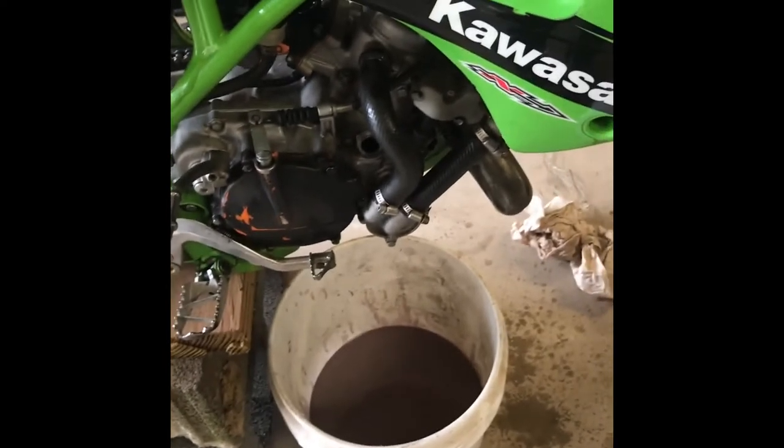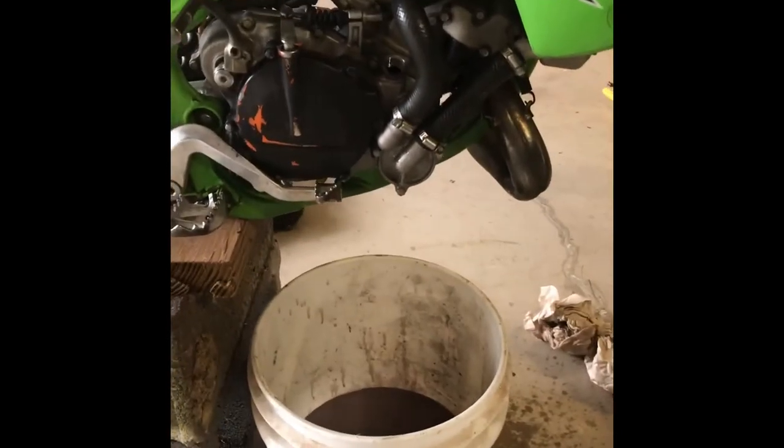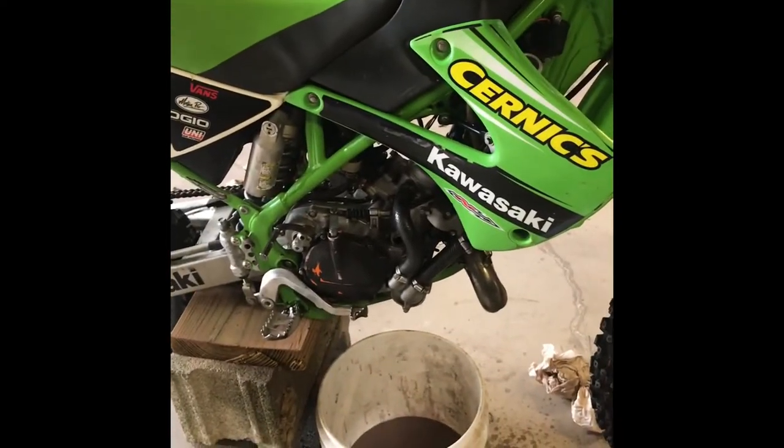All of our fins — or whatever they're called in between — should be good now. The engine should be cleared out for the most part. I'm not going to put water in the crankcase, because we all know how that would end. I'm going to let her sit for a couple hours, maybe even overnight, and we'll start ripping her apart, putting in the new seals and new bearings. There's still a little bit of oil in it, so I'm going to have to move the bike around to get it all out. But for the most part she's drained. So on the next step, tearing her apart.